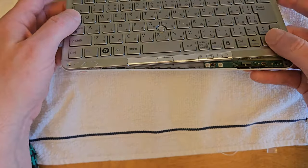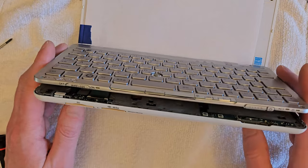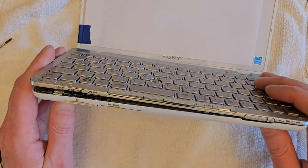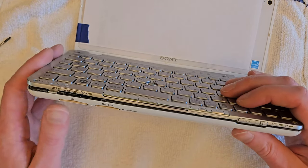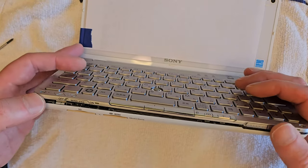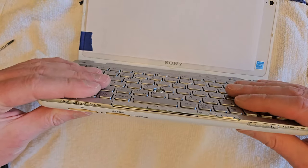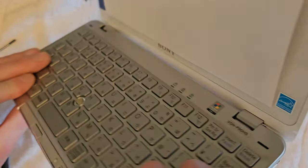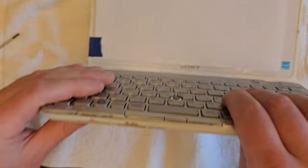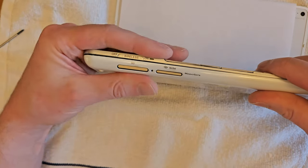And then the power button is a spring-loaded switch, so you need to make sure it's in the off position when you slide it in. Otherwise you can either damage the switch, or the switch may not actually do anything because it may not be engaging the plastic on the case, or the one on the motherboard. So you just have to carefully slide this around and make sure the switches don't move around as you're trying to fit this into the clips.